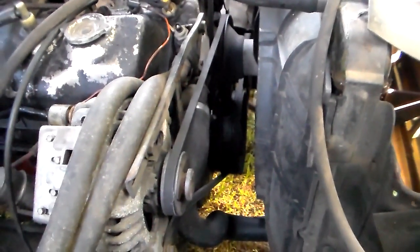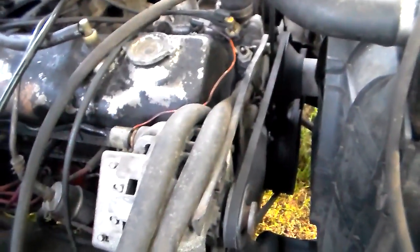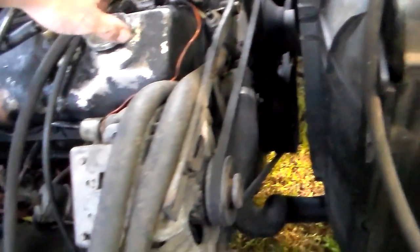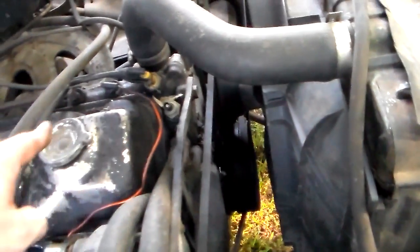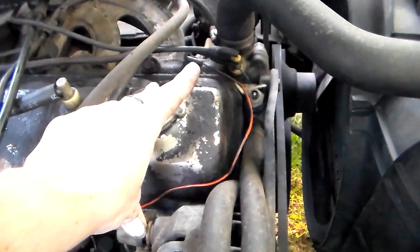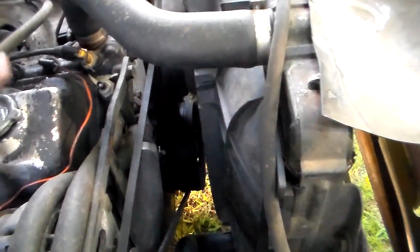Somebody said the other two marks are just so you can time each cylinder on top dead center. What I did to make sure I was right about that: I took the oil cap off, and when you take the oil cap off you can see the rocker arms for the first two cylinders on a slant six. You line them up with the ports — there's your intake port, there's your exhaust port. I rotated the engine by hand in neutral and watched until I saw the intake valve open up and then start closing again, and right after it started closing on number one, sure enough that big long mark came right up to the top. That was absolutely correct.